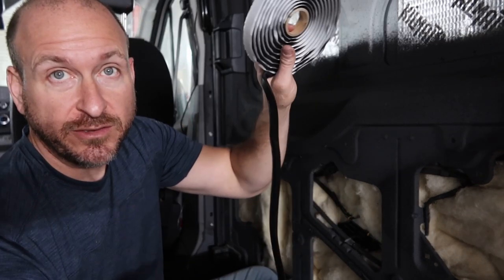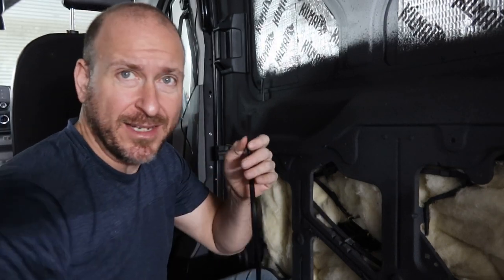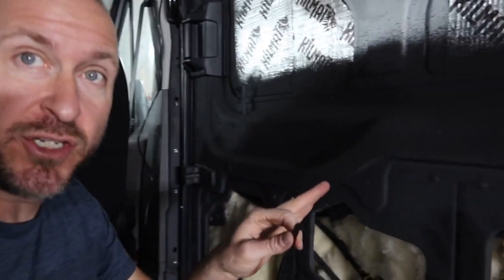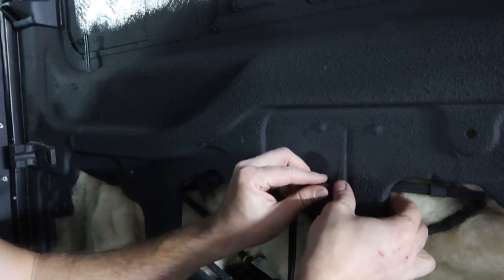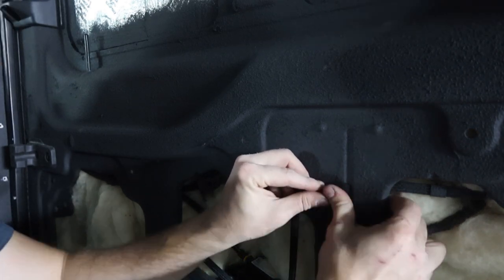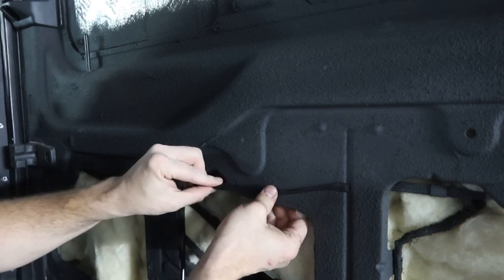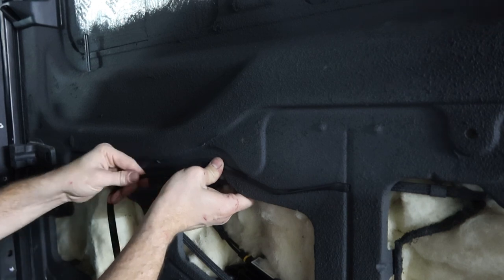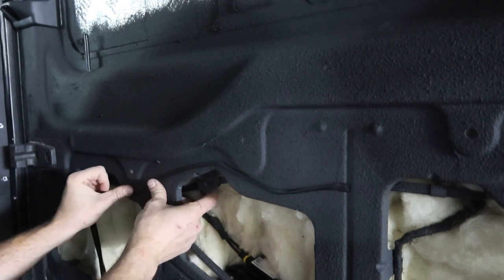I'm going to tape off a piece of plastic around this whole piece — the original piece was a bit piecemeal so I'm just going to redo the whole thing. This tape is just like tar — very hard to stretch, not like play-doh, much more thick in consistency. What's nice about the Lizard Skin is it's very rough, which I think is great for binding with the material. I'm going to press really hard to activate it, then stretch it, tack it, stretch it, tack it — just going around the whole thing slowly pushing and stretching it.